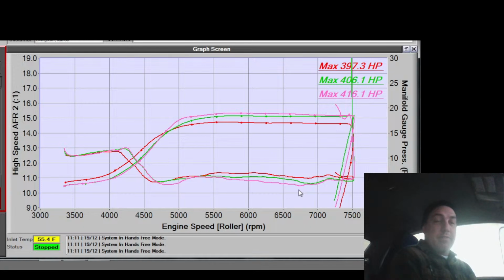It is snappy as shit though, off the, right there. Holy crap. It's a tiny bit too much fuel. It's really good there though. So it's just right off of idle. It's just a tiny bit too much fuel on tip-in. And I have these tip-in tables lower than I've ever had any tip-in table before on any Subaru with these injectors ever. That's how weird it is. I don't understand what's going on. Honestly, I just don't understand.